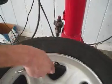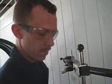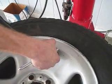Good point. So if it's a spare, you put more air in it than you would if it was going on the ground. Right, and this has tire monitors. If you overfill, you'll cause the light to come on. Tire monitors do exactly what the manufacturer's sticker says, if it's not a donut spare. If it's a donut spare that takes 60 pounds, do you put 65? No, I wouldn't do that to a donut, because it can blow your head clean off.